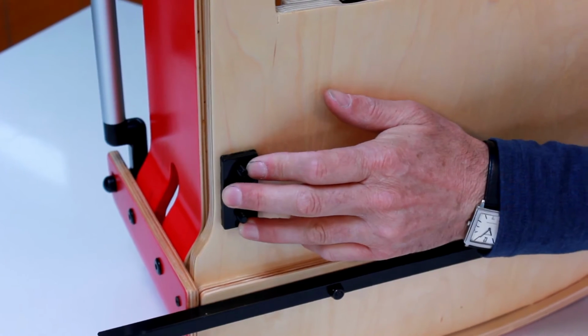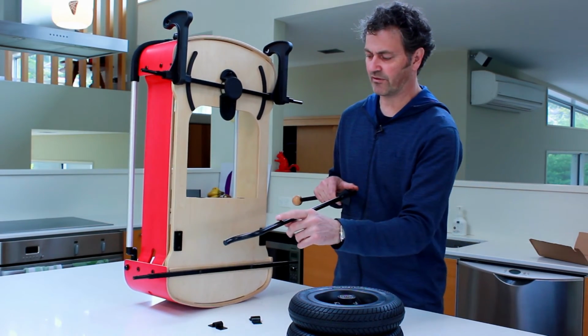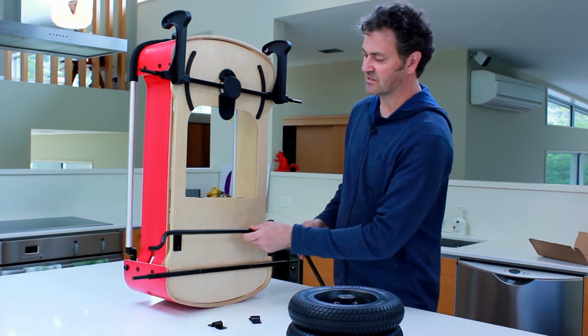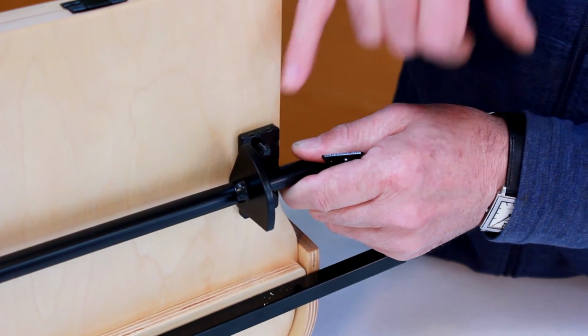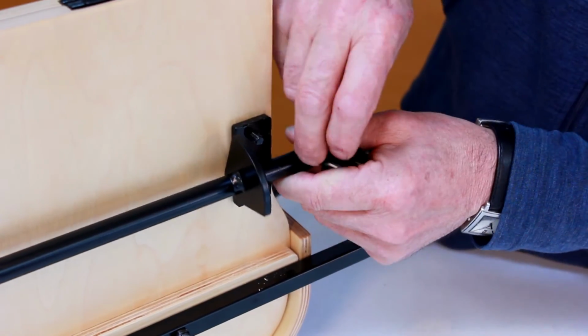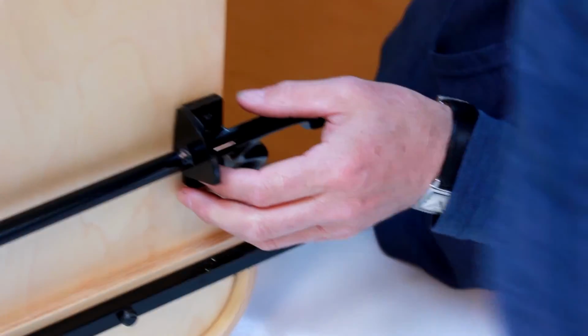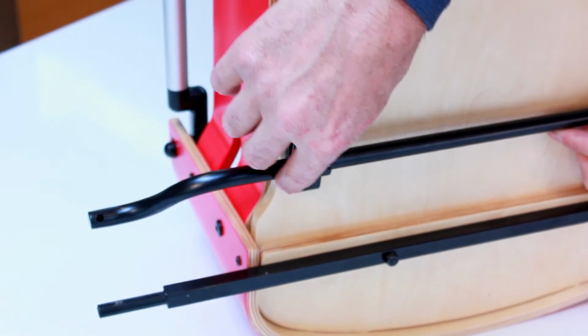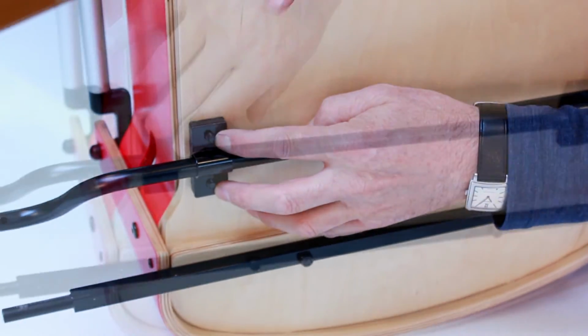And the second one. Now, orientating the axle. The axle has a stop on one side and a screw on the other. And they are to sit inside those metal plates. So the handbrake is to orientate between those 2 fixings. That's the correct position. Putting the outer cover on. You can see now that's how the brake orientates.